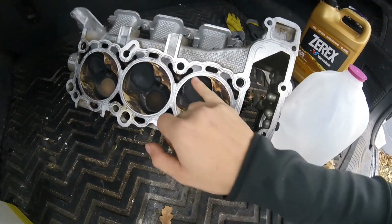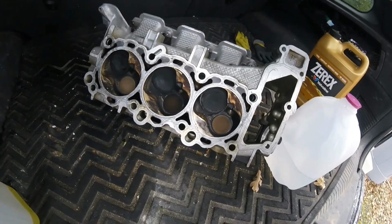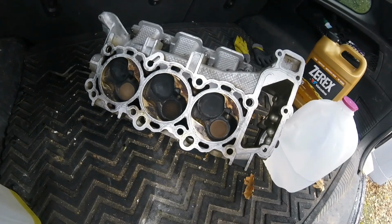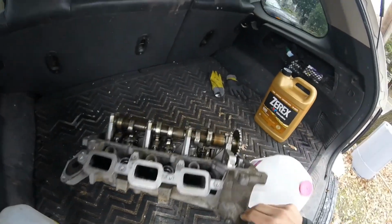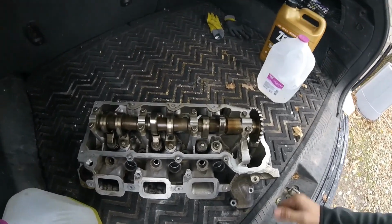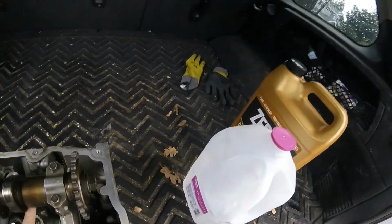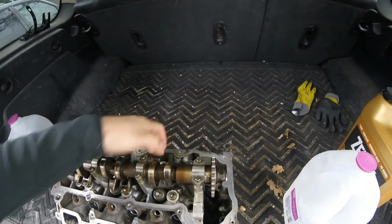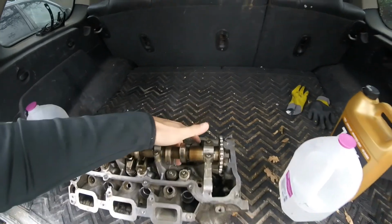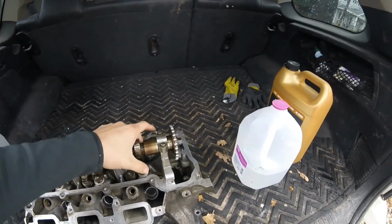But I think the seat is now fused to the piston. So it's worthless. I mean, they could have fixed it, but I'm pretty sure all these things would have dropped eventually. They have common issues because of the way they got pressed in, it doesn't have grooves to grip onto it. There are, of course, repairs to do it, but it's not worth repairing. The dealership describes this motor actually as a throwaway, which is horrible to tell a customer.